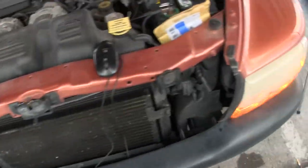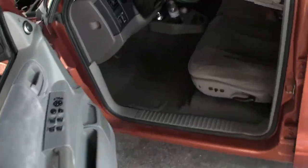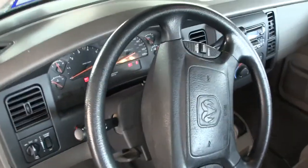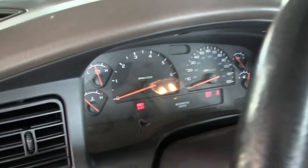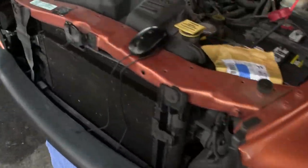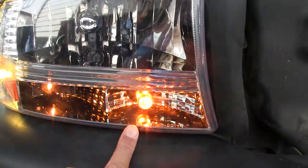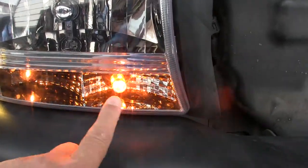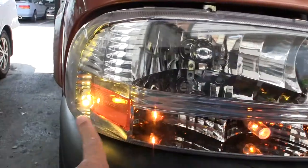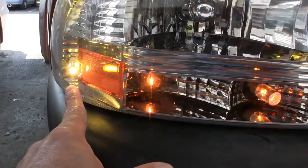I have to go back and turn those on again. Let's go back and put it onto the hyperflash light, which has the LED in it — hyperflashing. These are the turn signal lights, they're hyperflashing because that one's an LED and doesn't have the resistor in it. And this one is a parking light which is supposed to be on and stay on.